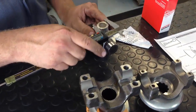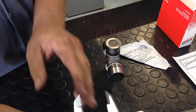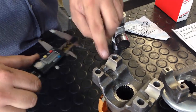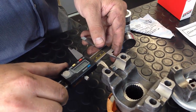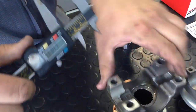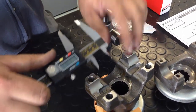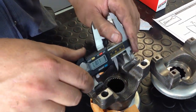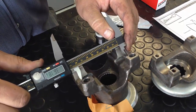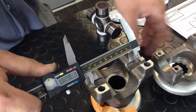If you have a U-joint that fits, that's easy enough — just measure across the top of the cap. If you don't, you have to measure the yoke, looking for the widest portion before it comes to the chamfer, and that's going to correspond to the U-joint cap dimension. So this 1350 measures at a 1.188-inch cap. Then, in between the two lockup surfaces, you need to measure that as well. If it's outside lockup, you'd measure to the inside of those tabs.